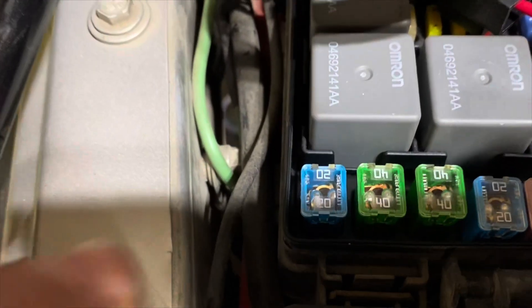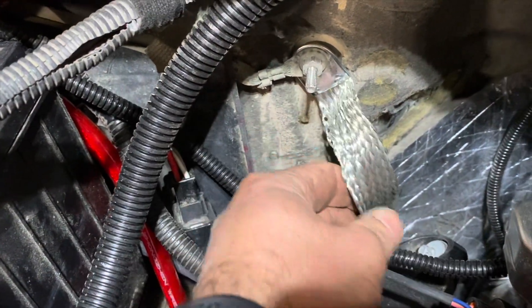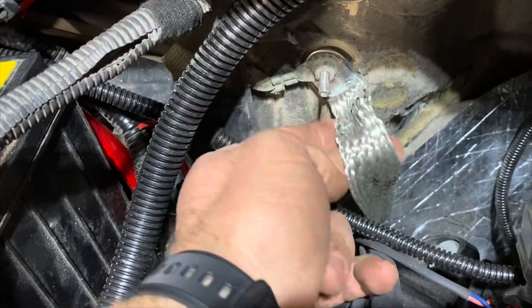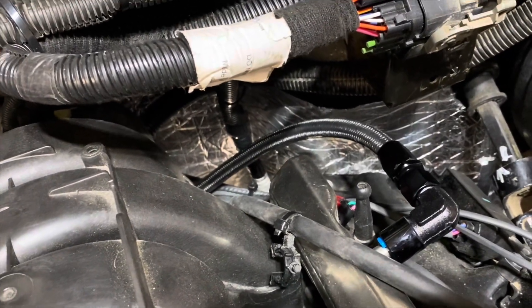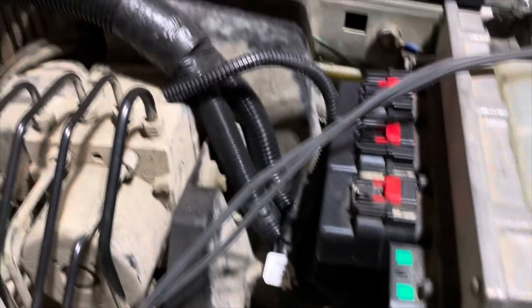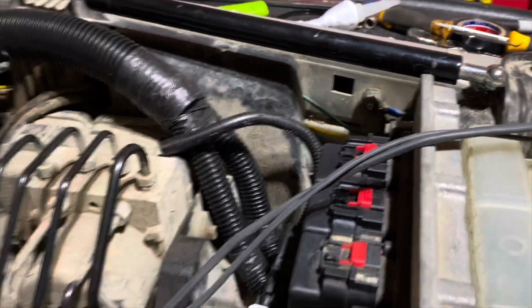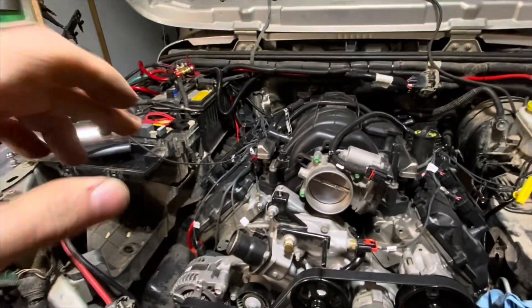That's already connected to that stud from the factory. I put on a bigger strap here — this goes to the back of the head, just right down here, just to that bolt. The ground strap from the main harness, I've got that down to the other head back there. Don't forget about that ground there — that goes from your computer to your fender/sidewall. Just don't forget your grounds. Be very thorough. Make some new lines if you have to — I've made quite a few new lines there.